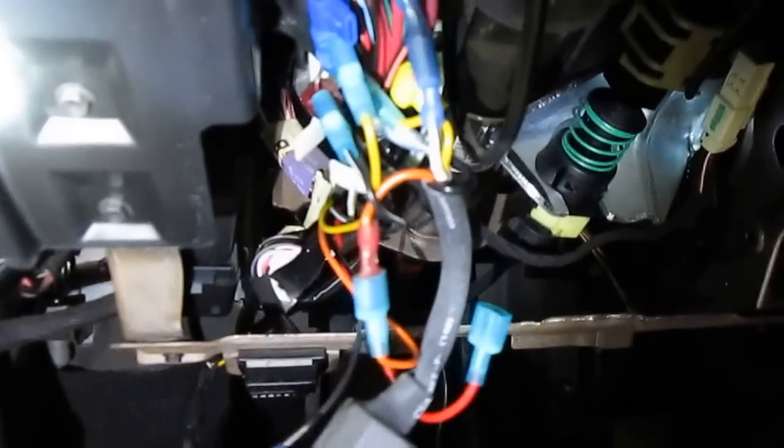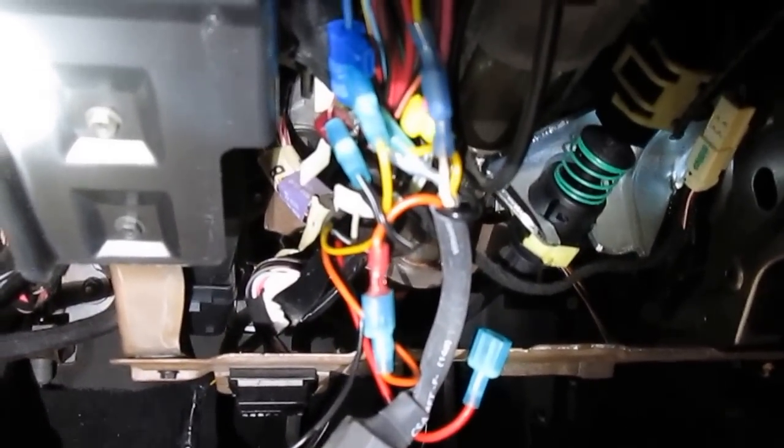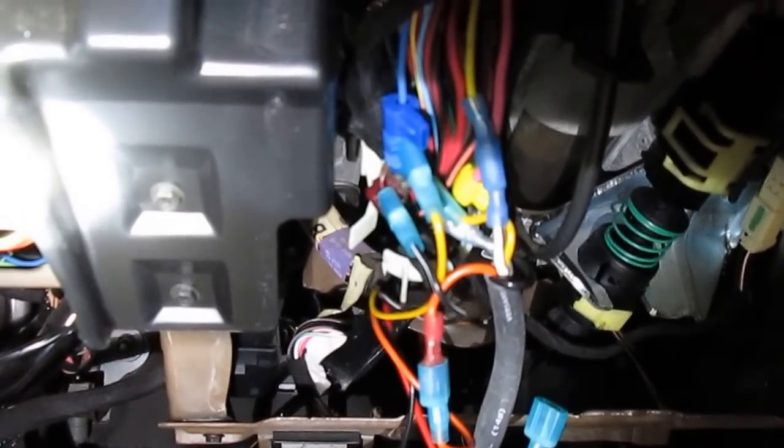What I'm going to do is remove all this tomorrow and get it out of the vehicle. Then we're going to get a new ignition switch put in, because when I turned the key off one time the engine kept running, and the key is kind of hard to move when you turn it into the housing.